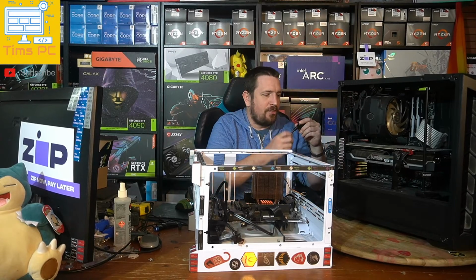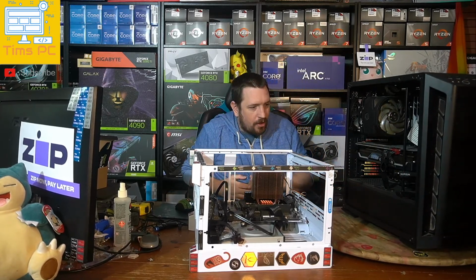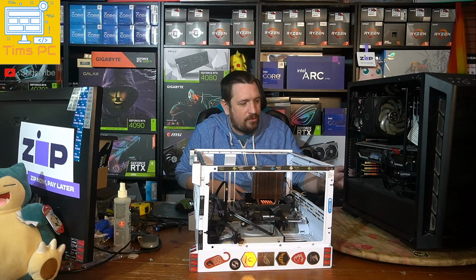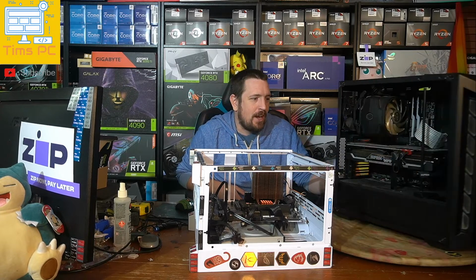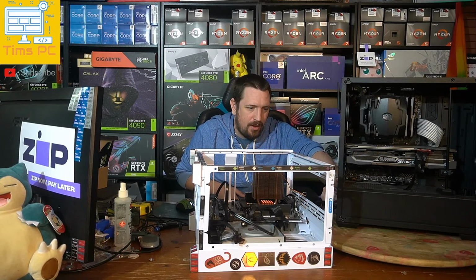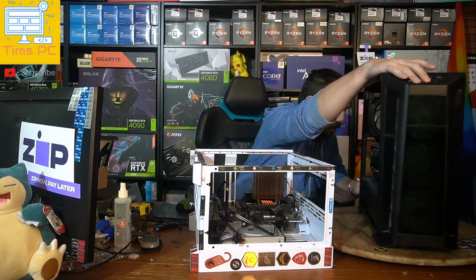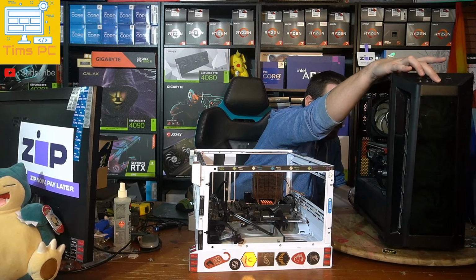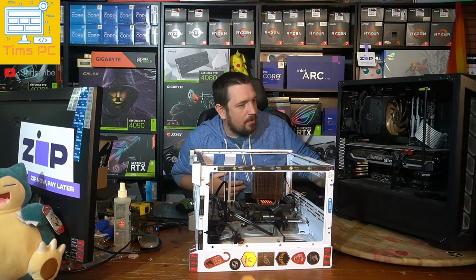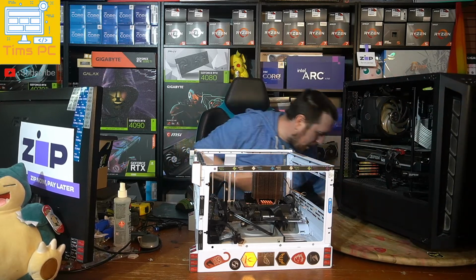And so obviously the first thing that we do is we just see what happens when we try and turn it on. Because I've got it on pretty good authority of what's wrong, the first thing we're going to do is test the power supply. So we don't even need any other cables hooked up to it at this stage. All we need to do to test the power supply is to turn it on and press our power on button, because we should be seeing something if we press the power on button. So, step one, we know that there's no power going from the power supply to the actual system.